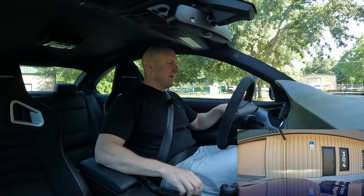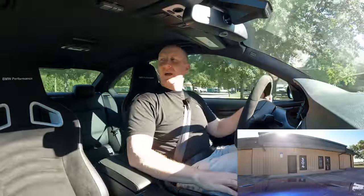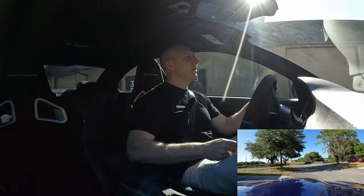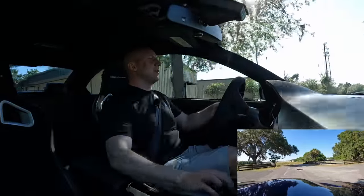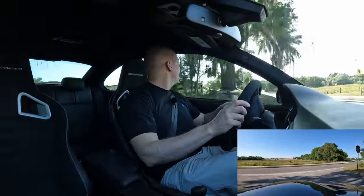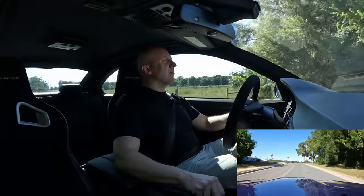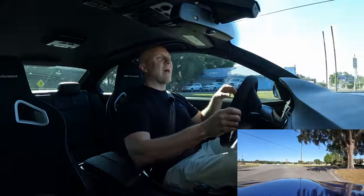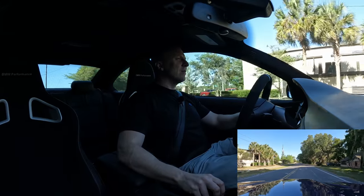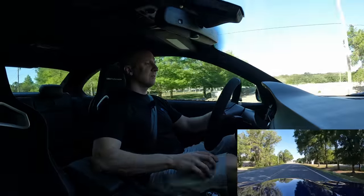The now 900-mile M3 is now road-worthy. Still don't have a suspension yet, but we've got some noise. And we took the clutch spring off, which makes the clutch operate so much better. American Racing headers are installed - Mike just did them. So this is my maiden voyage with them. My friend Alex from Alpine MSS just did the tune, so there might be a little bit of adaptation time. We've got the CEL tuned out and the power band smoothed out a bit. The M3 is coming together.